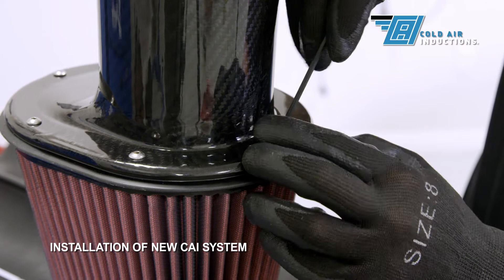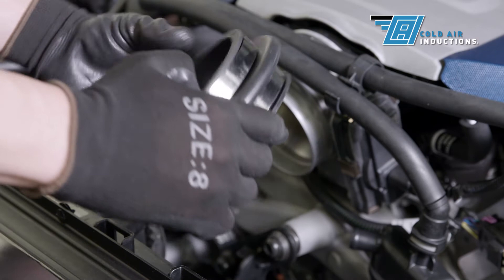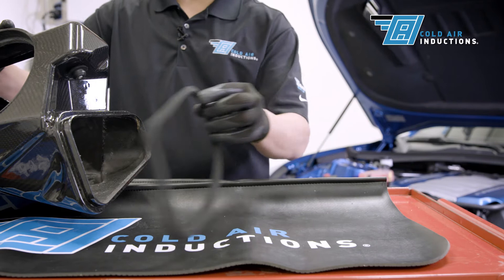Place the filter on a table with the open side up. Attach the intake tube and begin putting the six screws in place. Once they are in place, screw them down with the three millimeter Allen wrench. Connect the hump coupler with the arrow facing up, ensuring that the side which has lettering is facing the throttle body and the clamp screws are accessible for tightening. Tighten the clamp nearest the throttle body only.